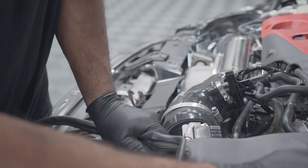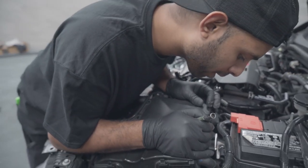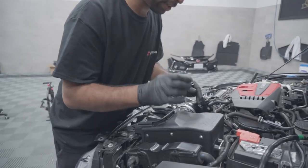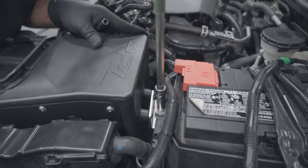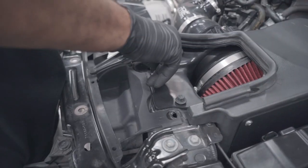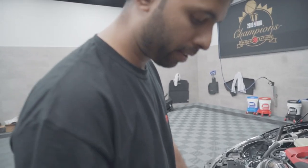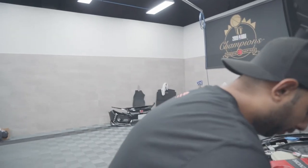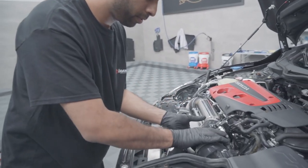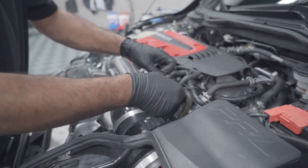Now that we have the air box into place, line everything up including the one screw in the back of the intake box. I start with that bolt on the back of the air box — snugging everything up by hand for now. Keep it loose because you are going to have to slide that panel in afterwards. Now let's finish up the inlets — rotate everything towards the back of the motor so that you have hood clearance as well.